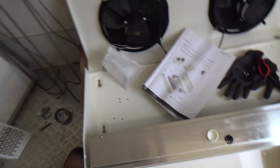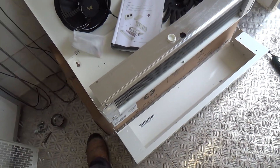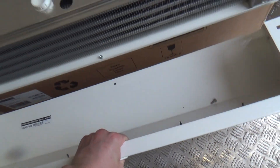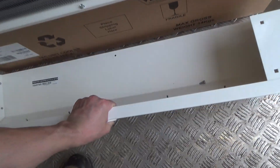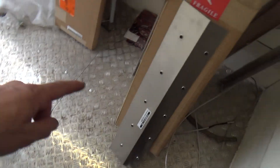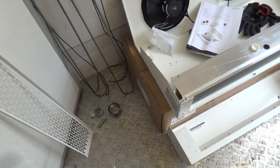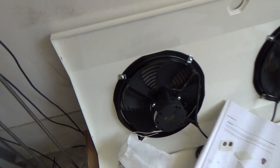We're wall mounting it because the roof slopes. When you wall mount them — it's the first one I've done — it's quite interesting. You get this kit that goes on there to change the airflow, and because it's low temp there's a couple of heaters that have to go on, some baffles for the airflow, and a grill to stop you burning your fingers when it's defrosting.